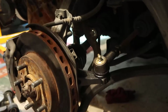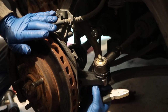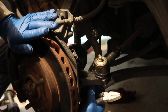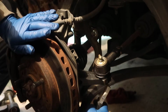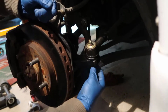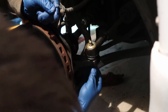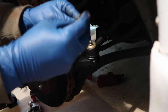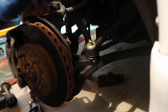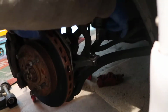Okay, so that's the tie rod. There is a little clip on the bottom. So you got the 2 tabs. Put them together and pull the clip out of here. Sometimes it's kind of hard. Alright, so I don't think I will be able to reuse it, and this should be basically hand tight. It doesn't quite matter because this locks that in place, so it's like this. It's quite dirty for the amount of time that I used it, because I remember I replaced it. That's out.